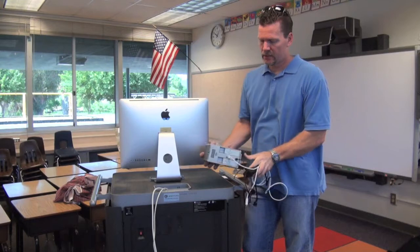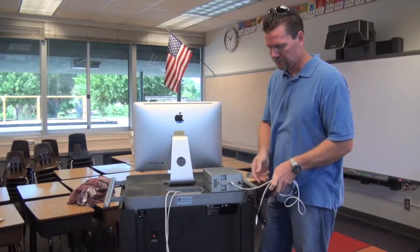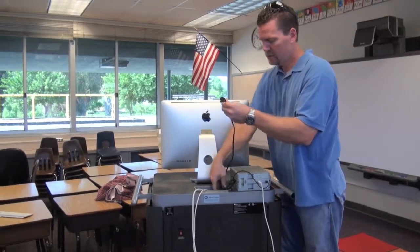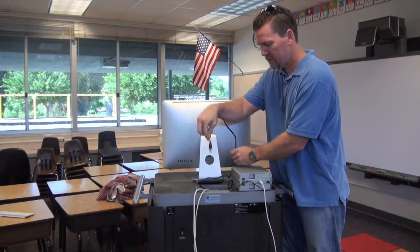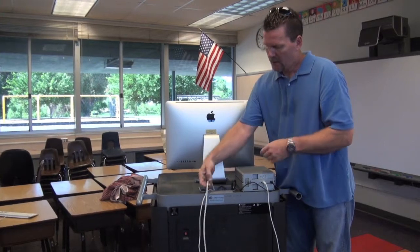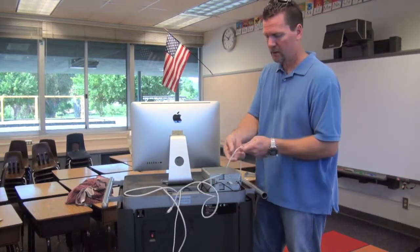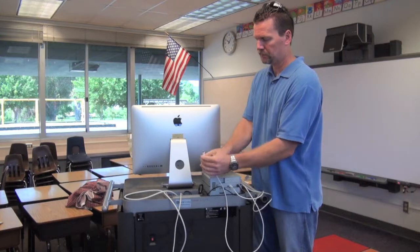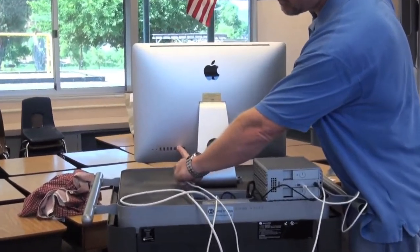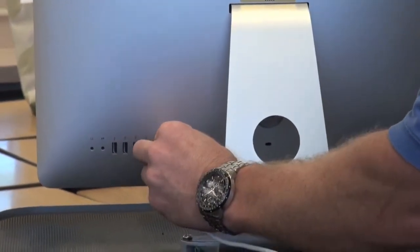With the Thunderbolt drive connected, I like to set the loose cable ends on the cart, though you might want them on your desk. The power cable typically plugs in on the inside of the cart — tuck it into the hole and drop the cable through. You can also plug your iMac into that same hole. Take the other end of the Thunderbolt cable and find the specific port on the iMac — look for the little Thunderbolt icon that looks like a lightning bolt — and plug it all the way in, keeping the rounded edge oriented correctly.